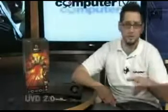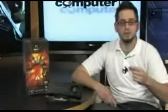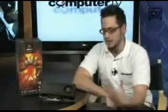It also has UVD 2.0 — Universal Video Decoder Version 2 — which is incredible because it lets you plug an SPDIF lead cable into the video card and instantly get 7.1 HD lossless audio through the HDMI cable, going to your television or receiver. You don't even need a separate sound card since the receiver handles processing and you're sending lossless digital audio over HDMI. The card also supports DirectX 10.1, Shader Model 4.1, and OpenGL 2.1, supporting Avivo and parallel graphics processing. Technologies like NVIDIA's CUDA will eventually be ported to run on ATI cards as well.